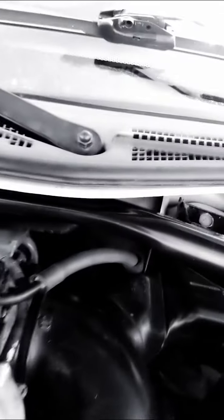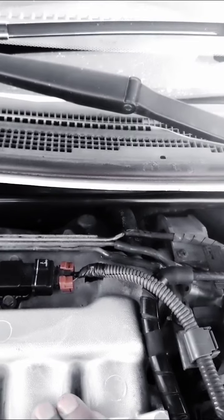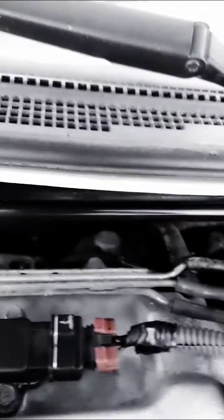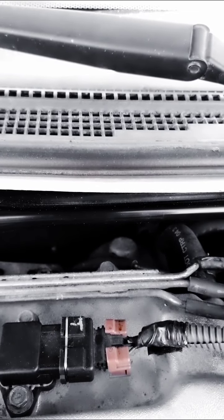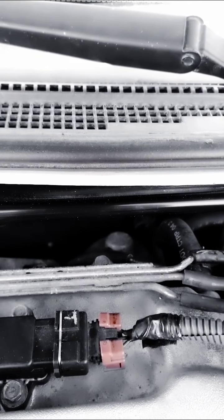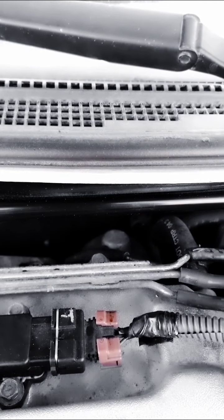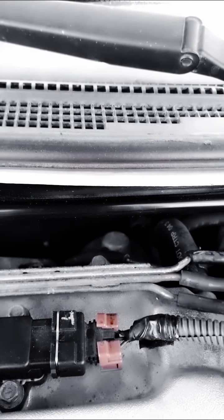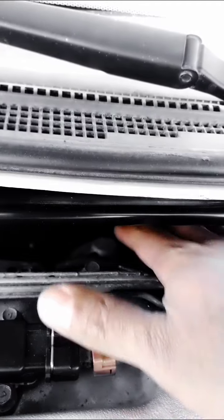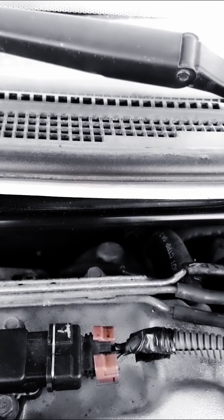It's easiest to put your hand in through this side and get at it. Once you get the EGR valve out, go ahead and spray carb cleaner in the ports. Use a whole can, and use a q-tip to clean it out really well. Let the carb cleaner soak in there for a half an hour, then clean it out good. Get a new EGR valve gasket.